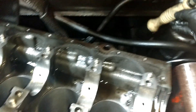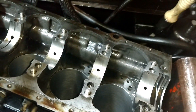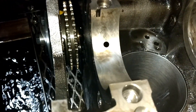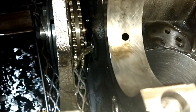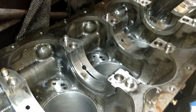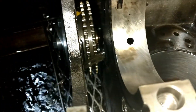I'm going to turn on the wash tank and put this down into the main oil passage. See how it's flushing out the main oil passage? I can do that through each of these oil passages for the main bearings — see it flushing out there.